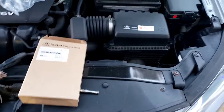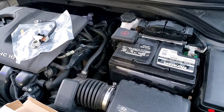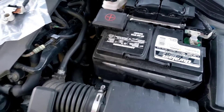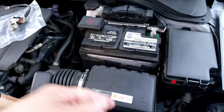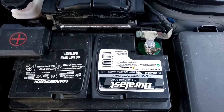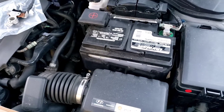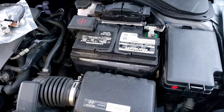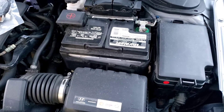We have a 2017 Hyundai Elantra with a flashing battery light — it doesn't happen all the time. This car had some trouble going through water, so it has a brand new alternator. The battery is only about a year and a half old, so the two remaining suspects in the charging system are the battery sensor attached to the negative battery cable and the computer itself. It's intermittent — it is charging — but every once in a while when you're driving or making a turn, the battery light flashes on for a bit then goes off.